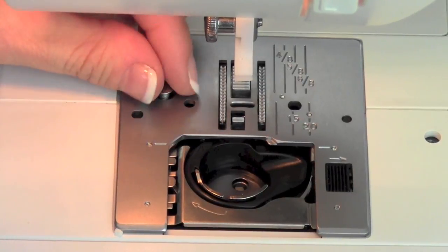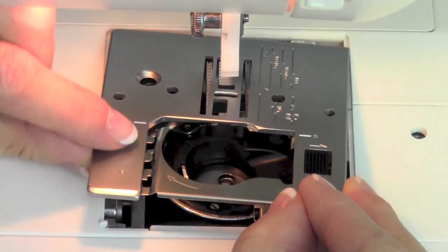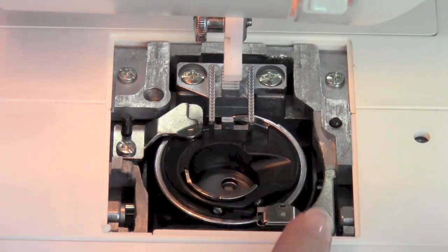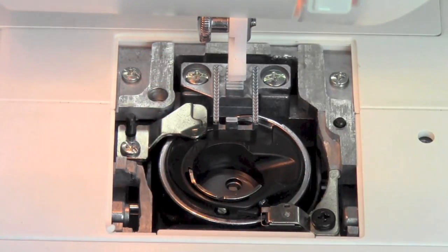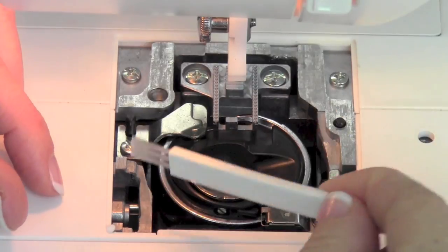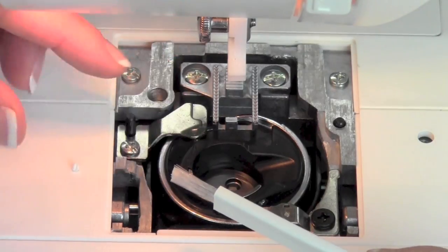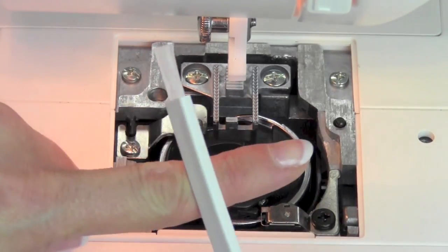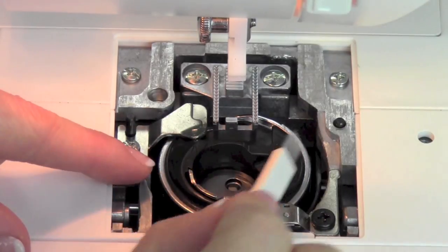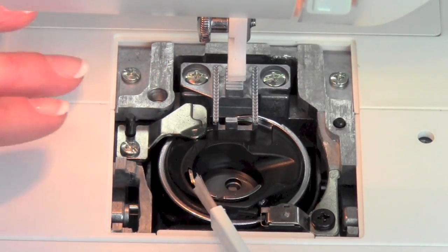It's under here that will show — if you were working on, say, green fleece, it will be completely green in here. We're going to just lift that up and slide that to the side. First thing you're not going to do if you have a lot of lint: just don't blow into it. You'll see there's lots of crevices — guess where it's going to go? Into your machine further. You want to bring it out. That's why you actually have the brush from your accessory bag to brush everything towards you. There are also miniature vacuum attachments you can get at your sewing machine store and attach to any hose vacuum — that's going to suck it out. Canned air is a no-no; do not use canned air in here, because that will force lint back into further places of the sewing machine and make matters actually worse. A lot will come out, but a lot goes in further than you realize.